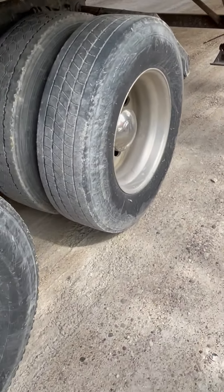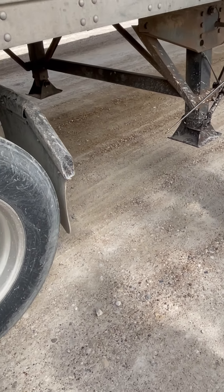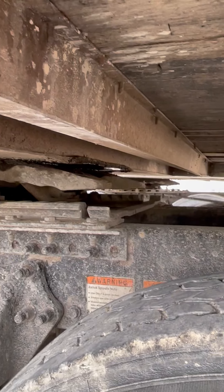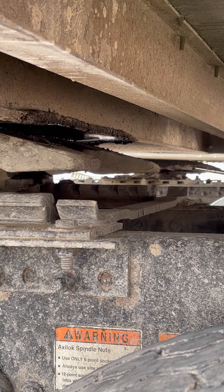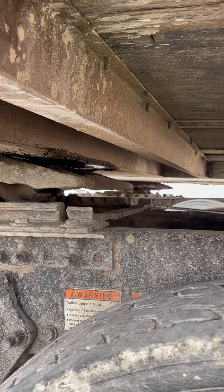From there, we're going to move back here. Get the proper clearance between my mud flaps and my landing gear — enough to make a turn. Look inside your fifth-wheel at your kingpin — properly mounted and secured, not cracked or broken. And then my locking jaws — properly mounted and secured, not cracked or broken, and they are locked around the shank of the kingpin. That is coupling.